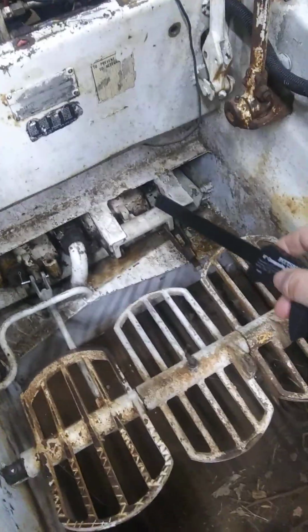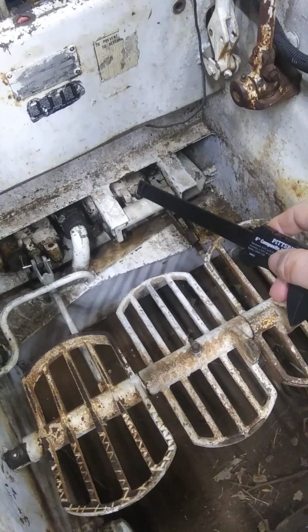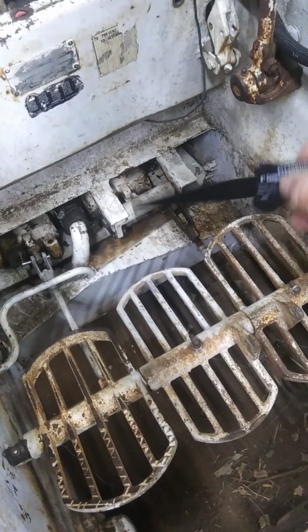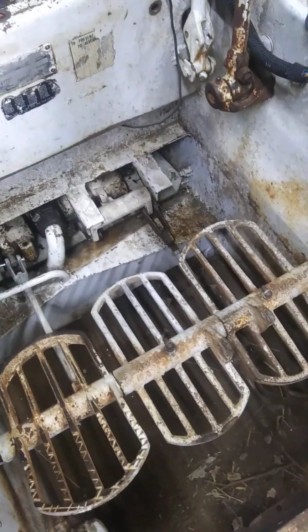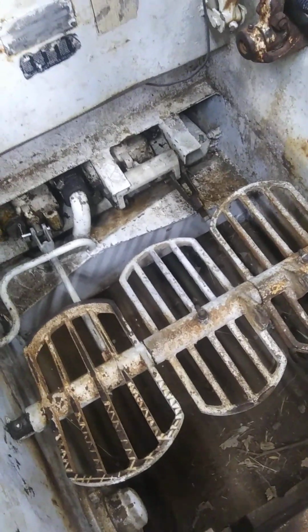My first clue about that when I look at it is that the grease zerk is right there on the back side facing the engine, and the zerk itself is facing down. So I'm thinking that's where I made my mistake on there. So I'm going to flip that around and hopefully the pedals will work.